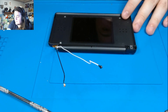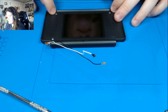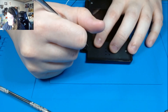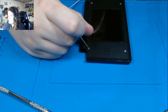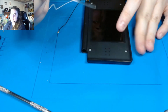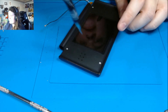We're going to remove this part and pull that out — this is the hinge piece. I either started prying these rubbers off previously, or somebody else did when I bought the lot. I'll show you on the white screen how to take these off. You just want to get a sharp tool — I typically use a dental pick. You can use tweezers, but they're not as clean. You can even use an exacto knife, but you risk damaging this hinge piece, so dental picks are highly suggested.